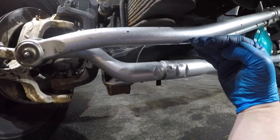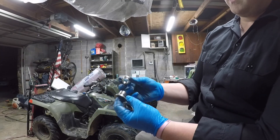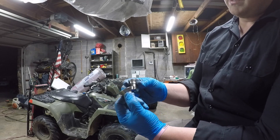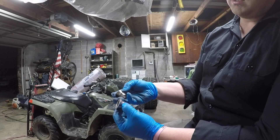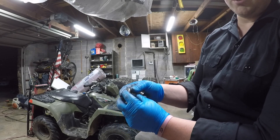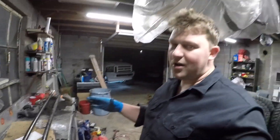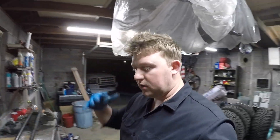I'm going to have it run straight for 16 inches and then do the bend up to the pitman arm. Before I go too much farther, let me show you the difference in your kit from Rough Stuff - they come with different-looking misalignment spacers. You can see the three different ones they give. These are for extra strength. I'll cover exactly where they go later when I install the kit, since you'll see this video straight through.